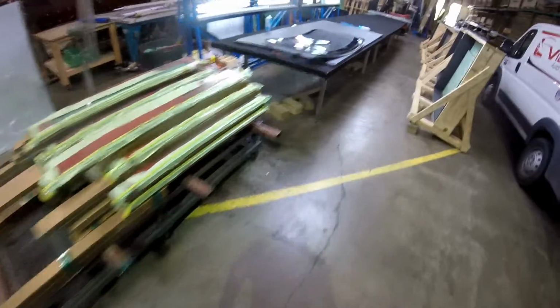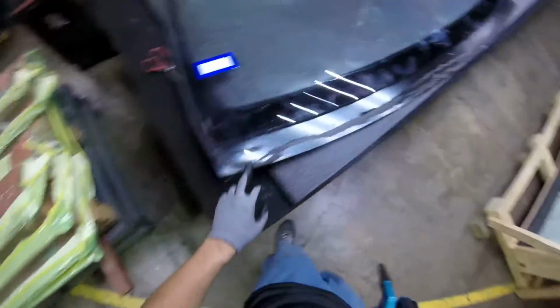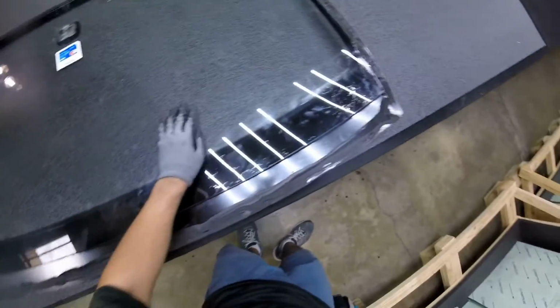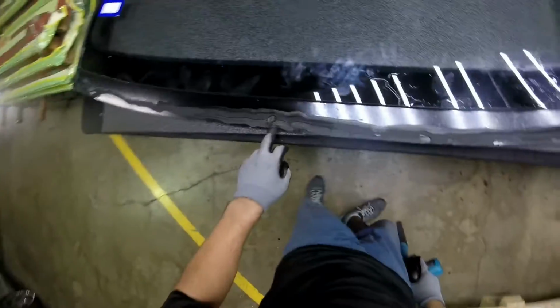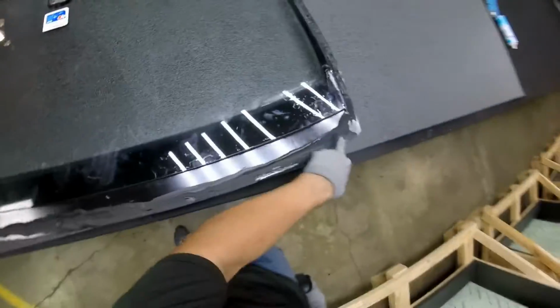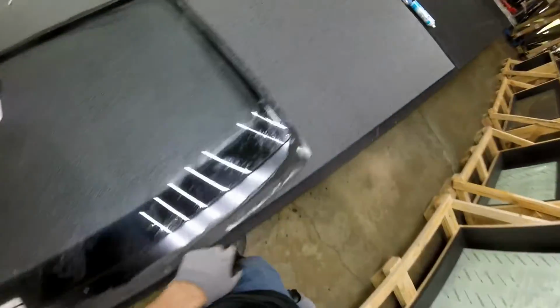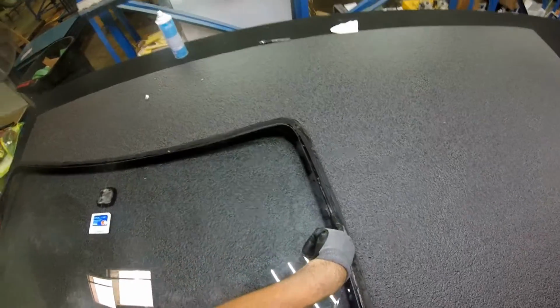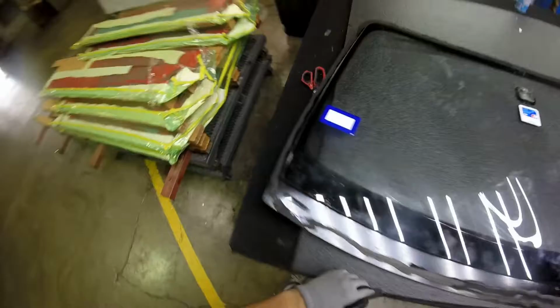Okay guys, we're going to pull the glass. Let me show you how the glass looks. Level 2. So as you see, we have a lot of glue on this area. Not really safe. The airbags are not going to make any problem, but the glass maybe was going to leak, you see. Some areas don't stick really good. The other ones a lot. Bubbles, lamination. Too close to the pillar side, but here that was more difficult with my spider, but it's okay.